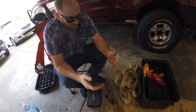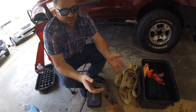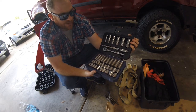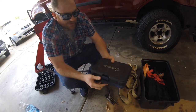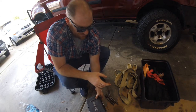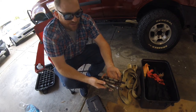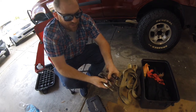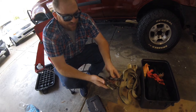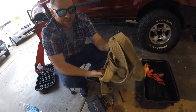That's the overview of my tools, spare parts, and recovery gear that I typically take with me pretty much anywhere in the Xterra, but especially when going off-road. If I had to narrow it down to my top recommendation in each category: for tools, it's got to be a good socket set or open-end wrenches in the correct sizes — up to 19 or 21 millimeters — covering the steering system, tie rod adjusters, tie rod ends, and upper ball joints. For spare parts, tie rod adjusters are what breaks first on a Nissan Xterra, so get heavy-duty ones or at least make sure you have spares. For gear, a $20 recovery strap is going to get you out of most situations as long as you know how to attach it to your vehicle.